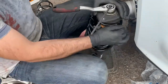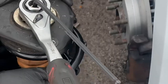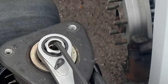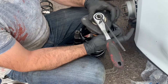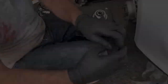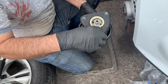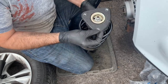I have to make sure that this lines up with the bodywork. When you insert it up to the suspension tower, this ridge has to be pointing to the engine. Then insert this onto the suspension tower and from the top try to screw it and put the securing nut in place.